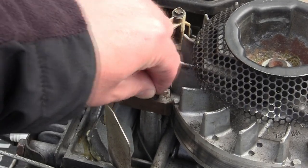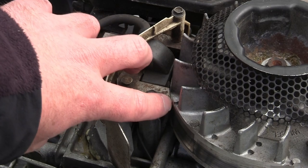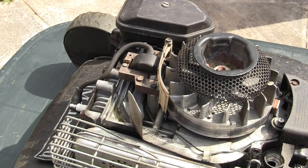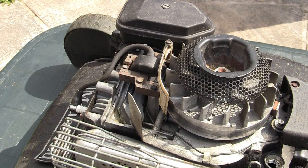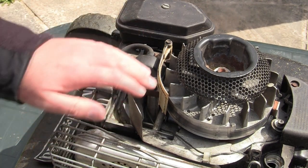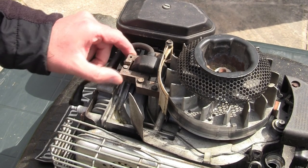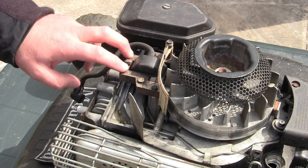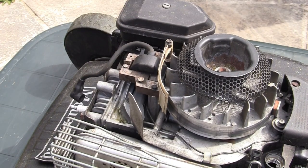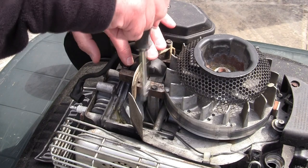The specs will be in the description. You could put a feeler gauge in there, but I'll show you how I set these up and why it doesn't really make too much of a difference. I often wonder why people ask about the coil gap — it's likely because the mower isn't running correctly, maybe revving up and down, and they're trying to find a fix. But in 12 years of doing this, I've had only one bad coil. It's more likely you'll have a break in the wire, or the wire won't connect to the kill switch, or the kill switch is dirty. Check those things before changing the coil.